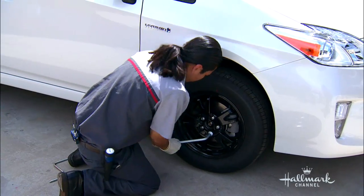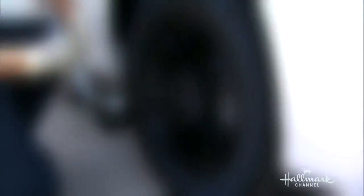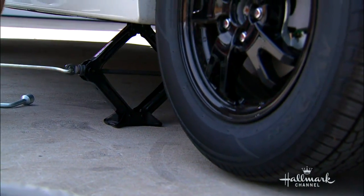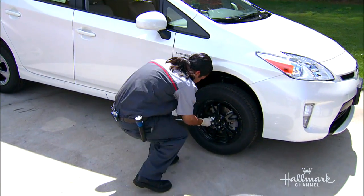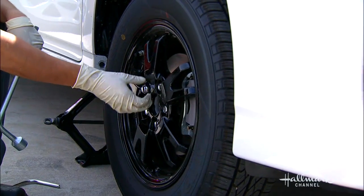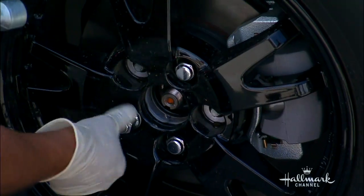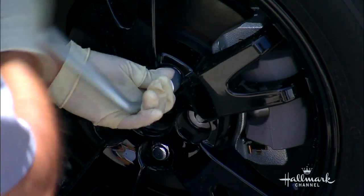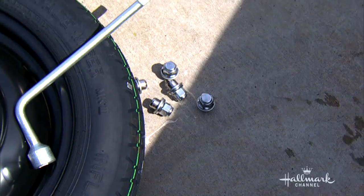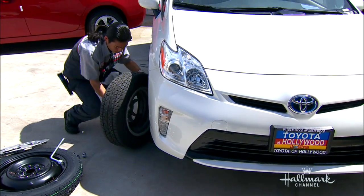Remove the hubcap. Use the wrench to loosen the lug nuts — this is probably the longest process of the whole thing, which should take you anywhere from 30 seconds to a minute and a half. Always counterclockwise, loosen them to the left. You want to make sure you jack the car a little bit higher off the ground before you remove all the lug nuts, because you want the wheel to spin. Remove all the lug nuts, pull the tire off the car, and make sure you place the lug nuts in a pile so they don't scatter anywhere.